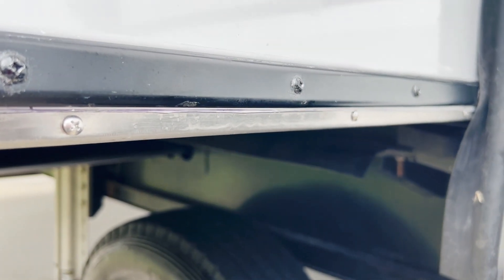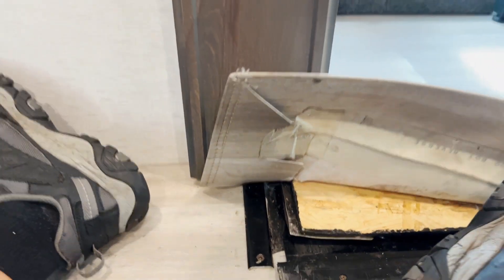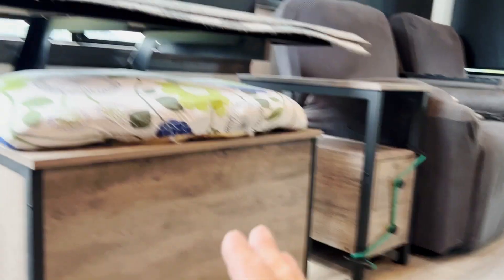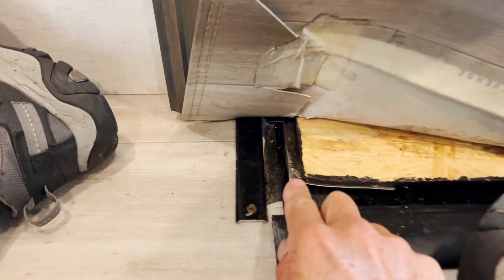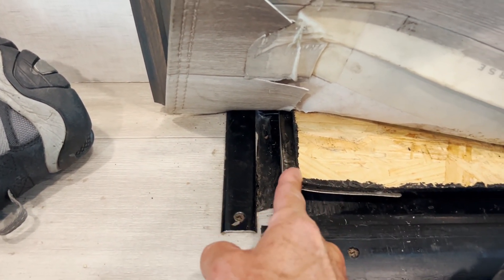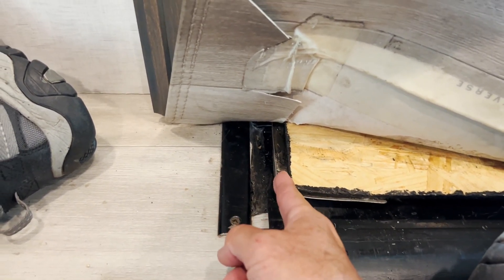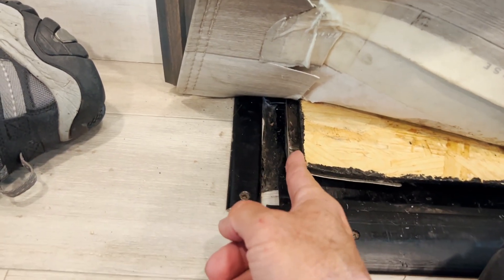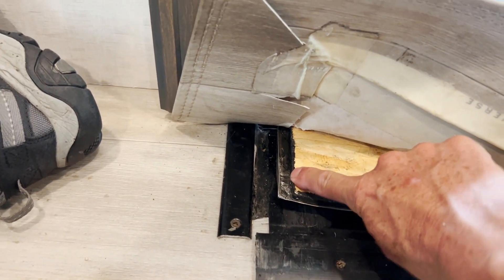I'm going to show you one more thing to check — a small issue I ran into — and I'll show it on the inside. Okay, we're on the inside now. This is our dinette slide, where the recliners and everything are. This is the same slide ski I was just working on adding the four screws to. You can see there's a pretty good gap from where the slide ski is to where the actual flooring goes. This flooring has a little black border — that's the undercoating. There's a good heavy quarter of an inch, maybe as much as three-eighths inch from the slide ski's vertical edge to the OSB flooring.